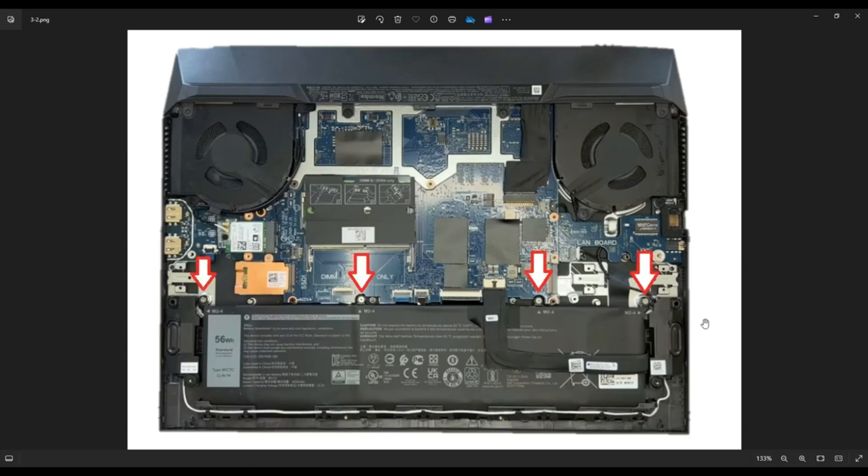To get your battery out, there's four screws along the top of the battery that you need to undo. After that, there's your battery plug right here. With any cable or wire in a computer, I always recommend not to pull on the wire if you have a choice — manipulate the plug if at all possible. In this case I had to kind of do both. I picked this cable up and put a pry tool right here. You see that black thing in your computer? It pops up a little bit. I had my pry tool on there and gently pulled down on the cable while gently pushing on that black part, and that got my battery cable out pretty easily.